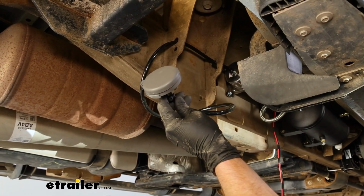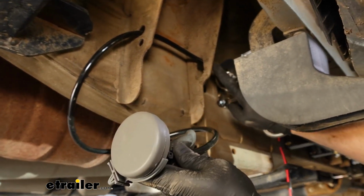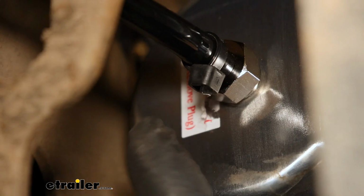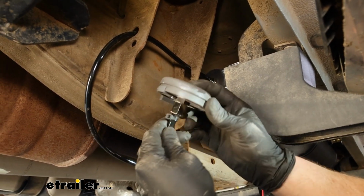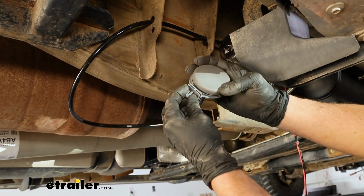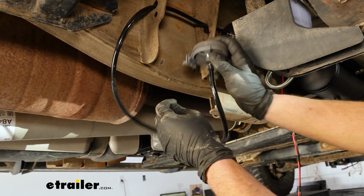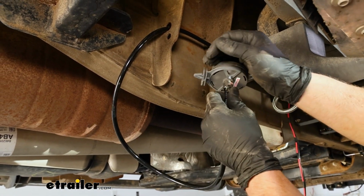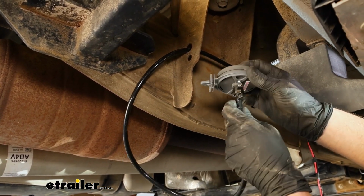As far as our air intake assembly, pretty straightforward. You just take the included hose. One end just pushes over that barbed fitting that we installed on the back of the compressor, and I like to take a zip tie and zip tie it for a little extra security there. Then the other end of the hose pushes onto the barbed fitting on the air filter, zip tie again. The way you can attach this, it has a piece here that can get pressed into a hole and lock it in that way. So up here in this area, I've drilled a hole that we can get this installed. I'll push that in place and show you where I put it.